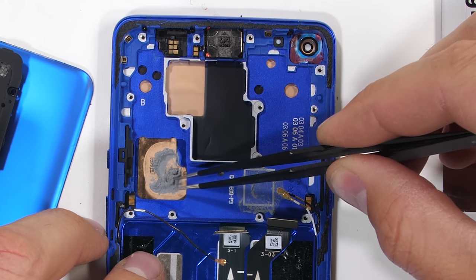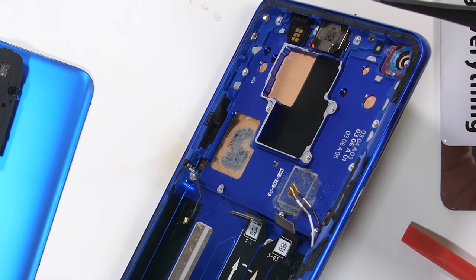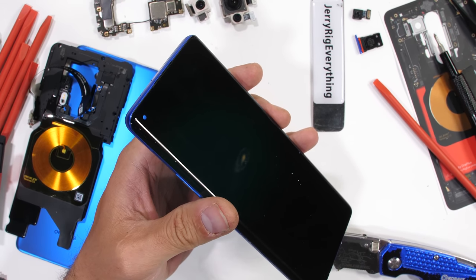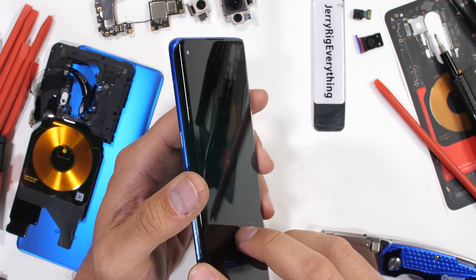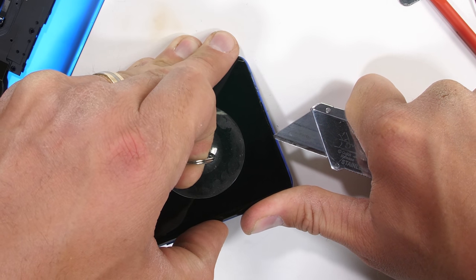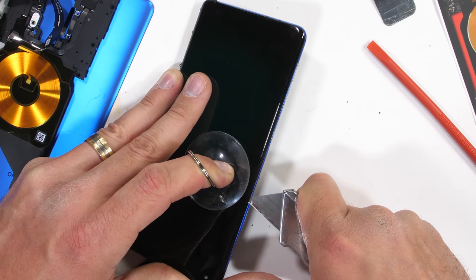It looks like the motherboard thermal paste rests in two locations — one on top of the copper heat pipe obscured by the frame, and the other using the blue aluminum frame as the heat sink. On one hand I really do like keeping phones alive when I take them apart, but on the other hand I also really like seeing the heat pipe and optical fingerprint scanner. Pulling off the screen to see them is certain death for the screen at least — the rest of the phone will still be fine. I say let's do it. It's rather smart of OnePlus to put the bulk of the heat pipe on the opposite side of the metal frame — it's easier to dissipate the processor heat through the thin screen than through the frame and the screen.